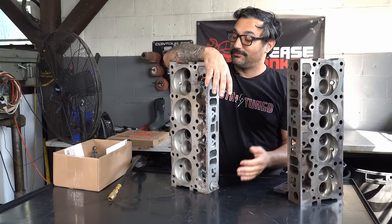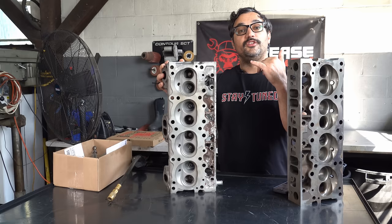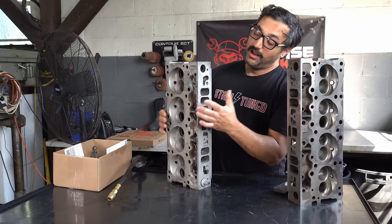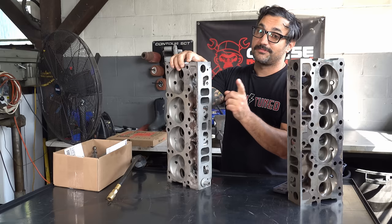The plan is this: engines need to flow air. You need to get more air flowing through your head — the head is where the horsepower is. What's nice about this is, yes, it's a huge pain in the butt, but it doesn't really cost a thing. I'm going to port some stock heads, probably pick up a bunch of flow and a bunch of horsepower, especially when we bolt a blower on this thing. It's not going to cost me probably more than a day's worth of my time. Free.